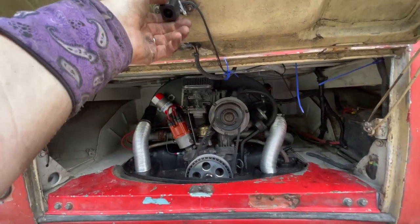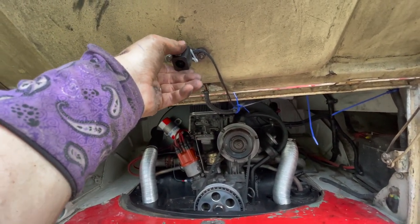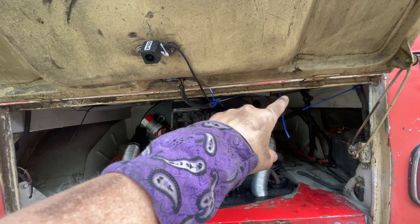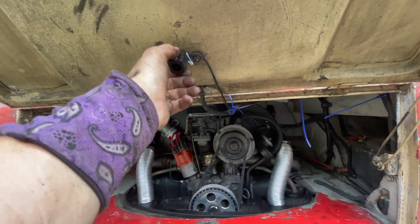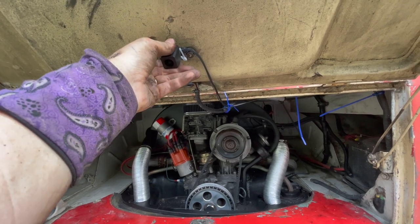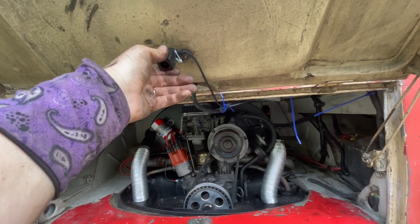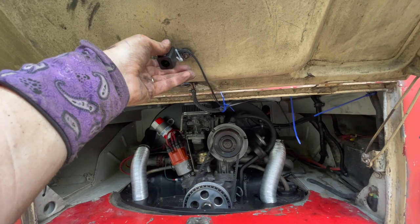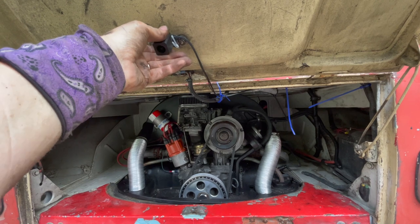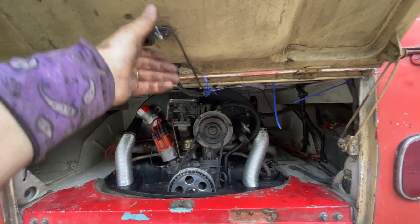All right, I got those hoses on, and it does feel like this is staying a little bit warm. So it's keeping power. So I'm just gonna leave it for right now where I can unhook it from that little connector that goes to the battery, but we'll have to wire that to the key. I don't want that to stay on, run my battery down. These are designed for RVs, so they have like a house battery that would keep it charged. So it's not hot, but it's just warm. I just kind of bumped it and noticed it was warm, and it's not on up front. So I definitely think it's draining, pulling power. So we'll just unhook it for now.